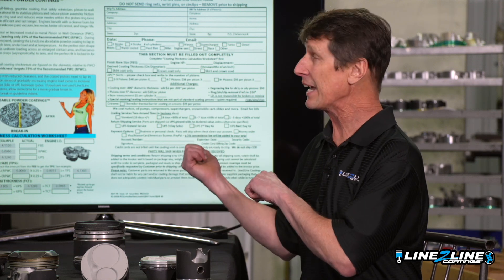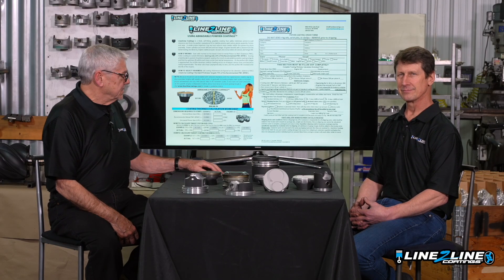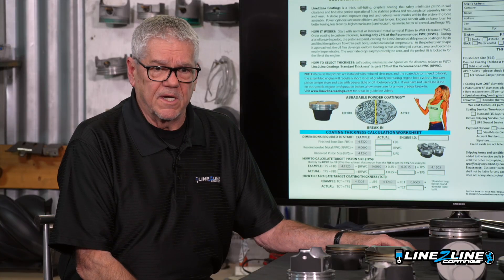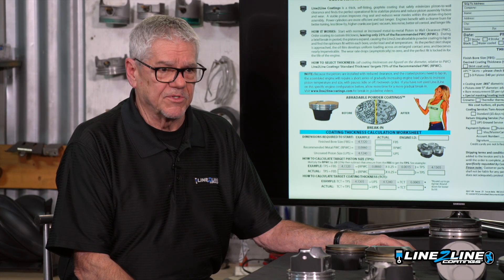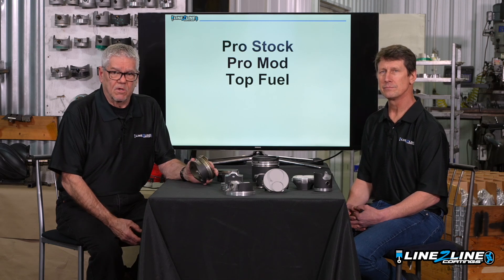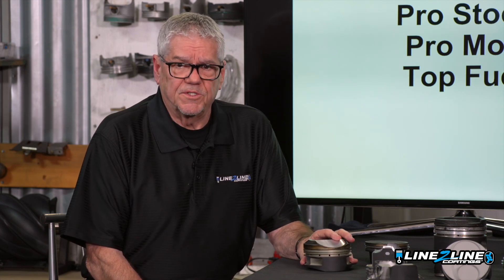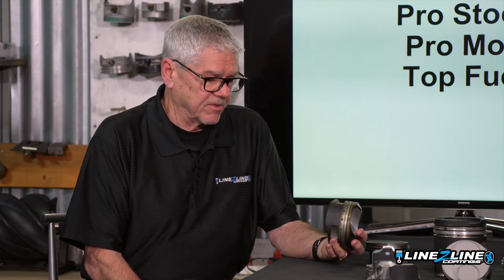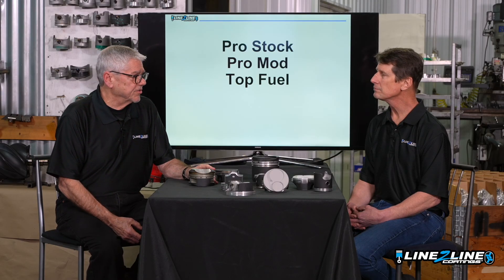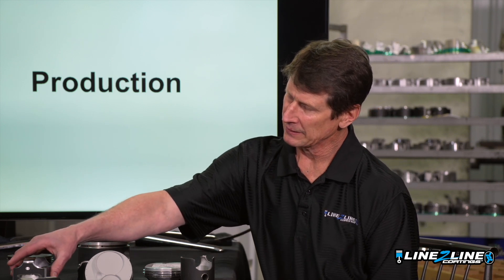It's really a trade-off, and that's why we want you to think ahead when you're ordering and think back to your order and your build when you start running the engine. It's important to have a break-in strategy before you place your order — look at the calculation sheet, follow the instructions, review our videos, and if you need more advice give us a call. For pro stock, pro mod, and top fuel category engines, you might find yourself with no time for break-in. Sneak up on these clearances: start with 30 or 40% of clearance, sometimes up to 50%. If you don't like what you feel, Scotch-Brite is going to get you back down a little bit, and once you've established a recipe you might want to consider a harder coating like Tribaloy.